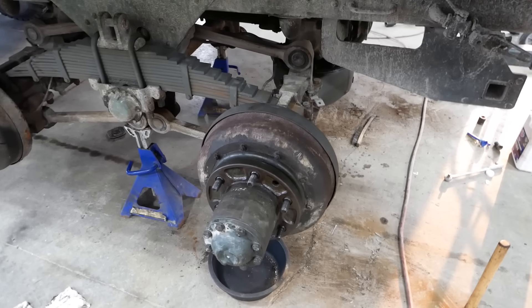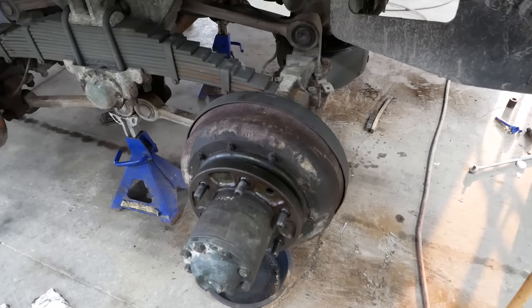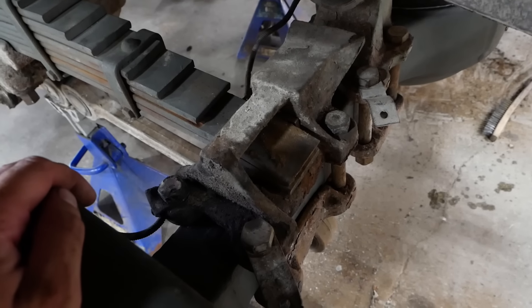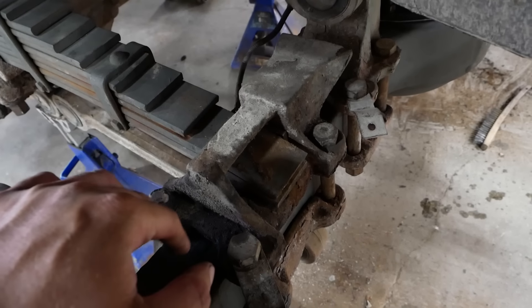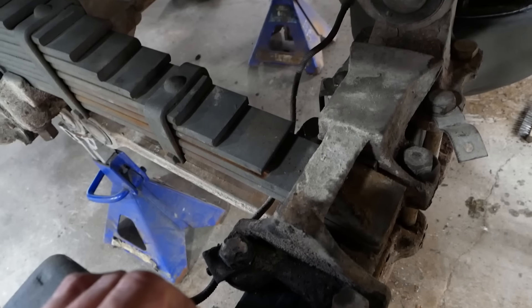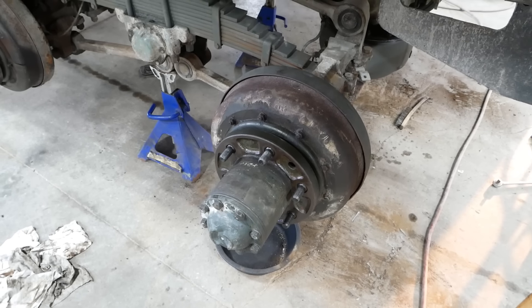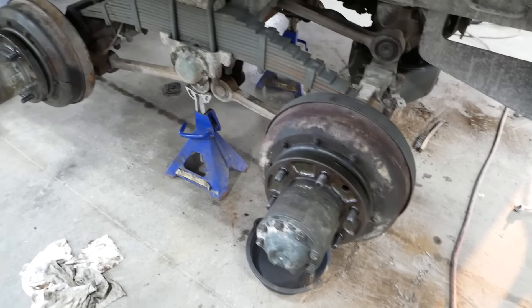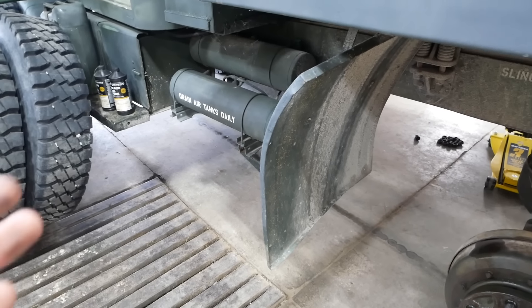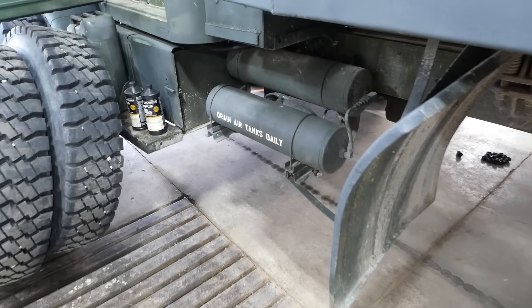It's in. It's pretty straight. There are 12 three-quarter inch bolts through the various torque rods and spring hangers, four half-inch bolts in the driveline, and one brake line. I went ahead and bled the brakes — just like bleeding any hydraulic brakes, nothing to it. There is one catch though: someone reached out to me from YouTube, he has a channel called Tactical Repair, and he mentioned that these trucks originally would have had DOT-5 brake fluid, which is a silicone-based brake fluid.